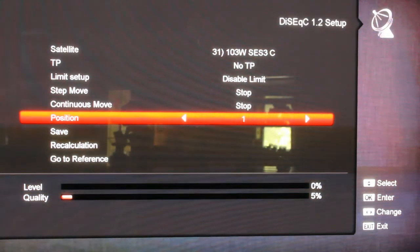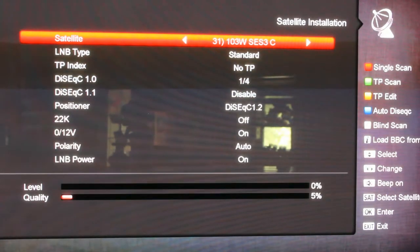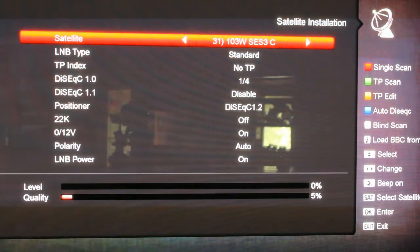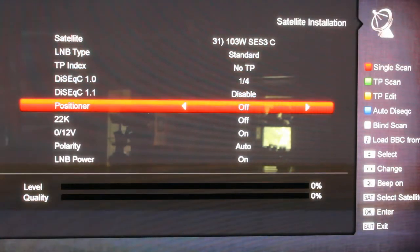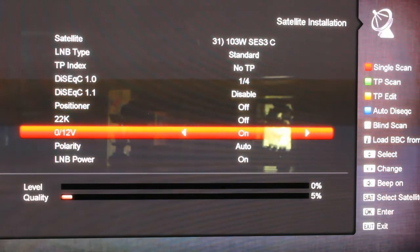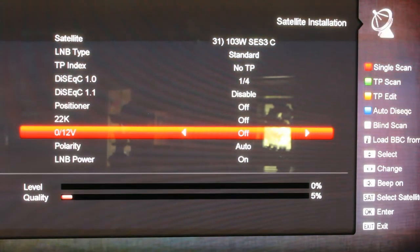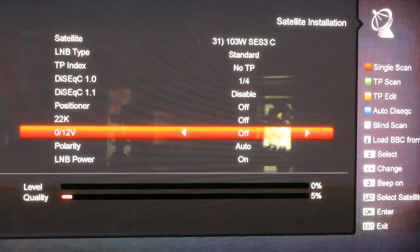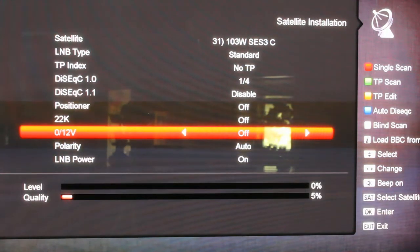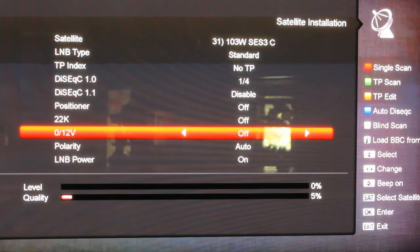I'm not going to go through all that right now. Like anything else, you always hit menu to go back one menu step. If you hit exit, it will take you all the way back to watching TV — what I call TV mode. If you've got a 22 kilohertz switch, there's where you do that — you can turn it on or off. This other setting isn't going to matter; it's something left in from other receivers they sell that have a little 12-volt jack on the back for accessories, but it's not brought out on this receiver.